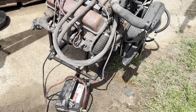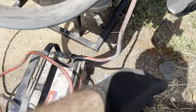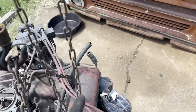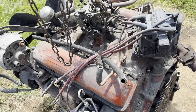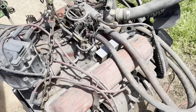Excuse the wind. Got a couple of battery cables hooked up here backwards — of course, red for negative, black for positive — hooked into the starter. I'm gonna turn it over a few times without any power to the coil, just so we can make sure we have oil pressure. Even though I don't have anything hooked up for oil pressure, so it's gonna make a mess if it does run. But yeah, we're just gonna turn it over a few times.